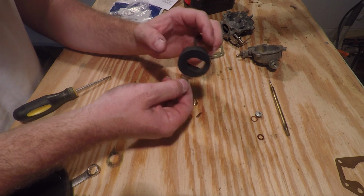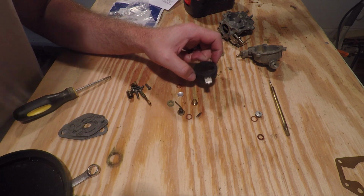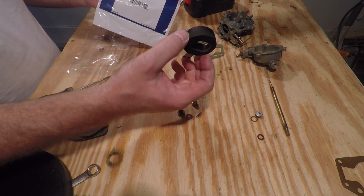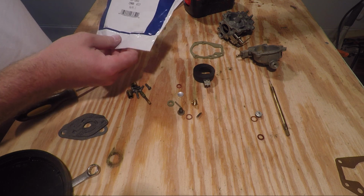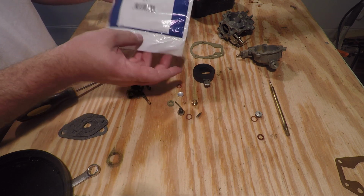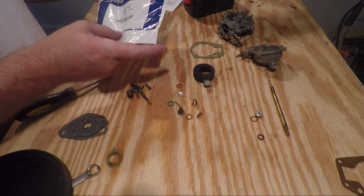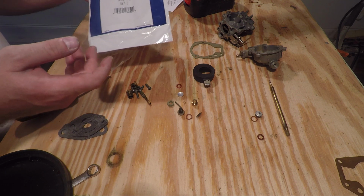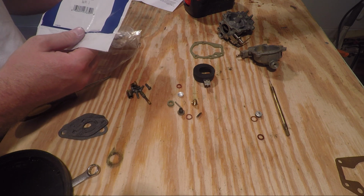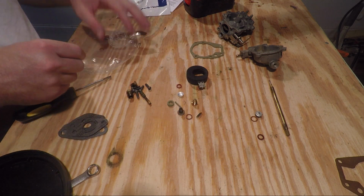The float is in good condition. It doesn't need to be replaced. This kit does not come with a float. I'll leave a link to a new float in the description. I couldn't find a kit that included a float, a different part number that included everything you see here plus the float. Some other motors or carburetors have that option, but I couldn't find it for the 6 horsepower. So I'll leave a link to the float in the video description.